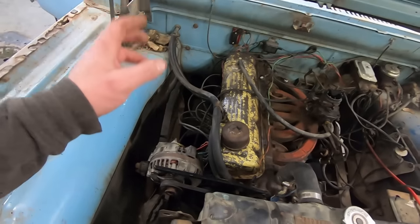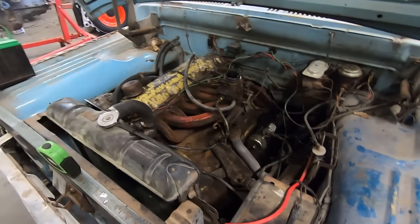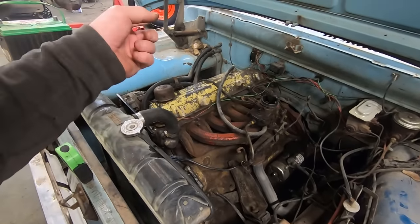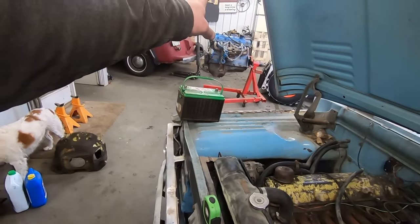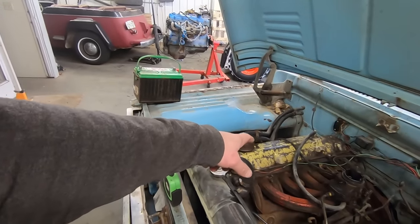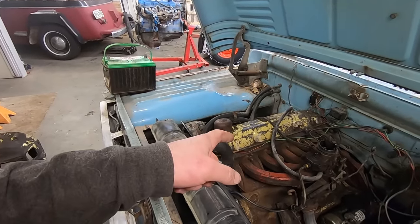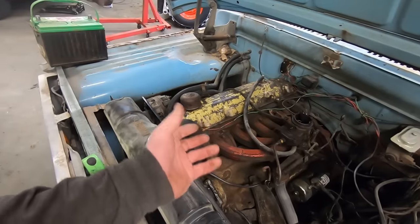Minor details. I think we're gonna have to adjust timing. Didn't see any coolant leaks. We got her full of some type of synthetic blend, 10W30. New Wix filter. Spark plugs, those were like a 5/8 hex. These are 13/16, and the thread depth was way different. So I just opened up the gap on these to 45 thou. So we should be good to go, maybe.